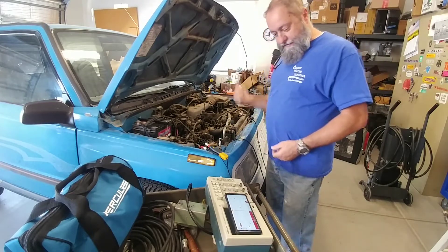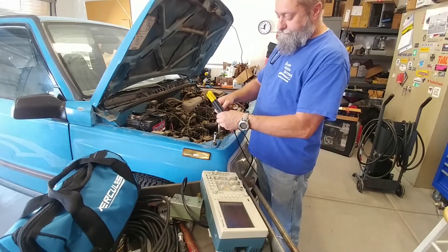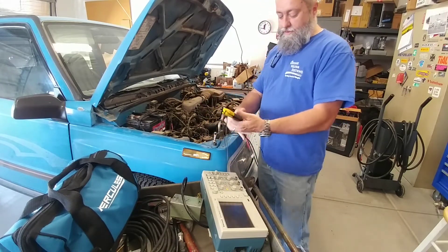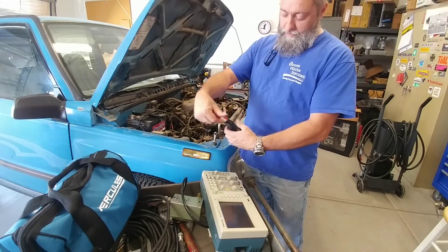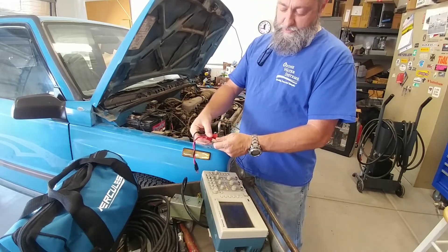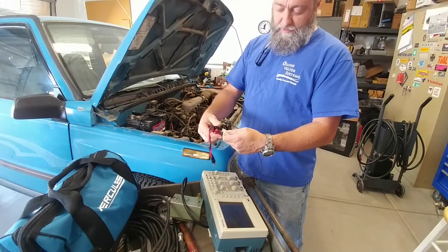Let's start the car up and see if we can get a good reading. The HT25 needs an inverted signal — there's no invert function in the Pocket Pro, but all you have to do is switch the polarity of the BNC jack: just swap negative and positive.